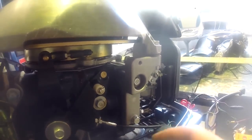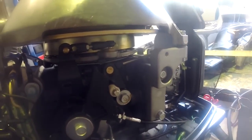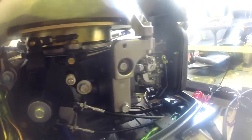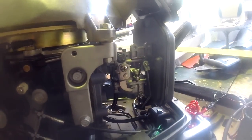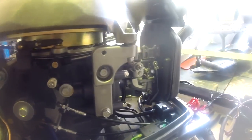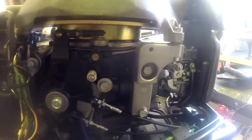Yes, some areas can run a little more smoothly. For example here, you can see where these mechanisms run over a cam-style arrangement, I guess you'd call it. A little bit of grease on there can make it smoother, but grease can also collect a lot of dirt. So if you do start greasing linkages, which is definitely a part of the service process, make sure you do so reasonably sparingly. It's usually just a small dab, wiping these types of surfaces. Any linkages, ball joints, can be lubricated, but with a less-is-more attitude.